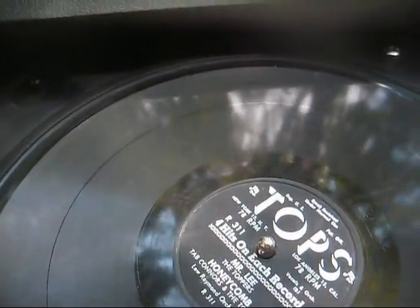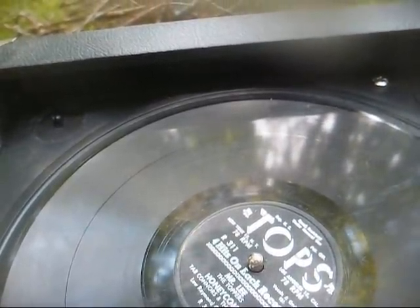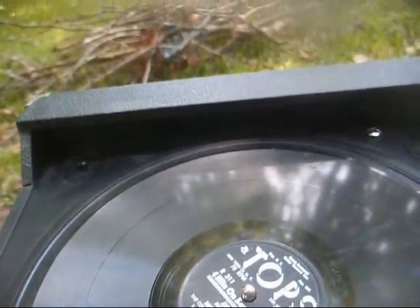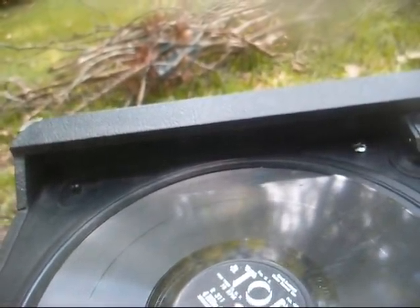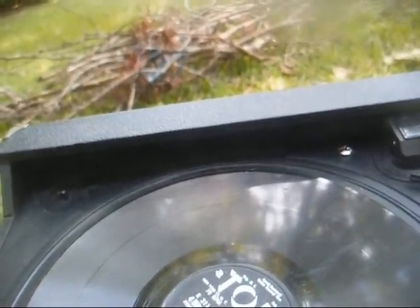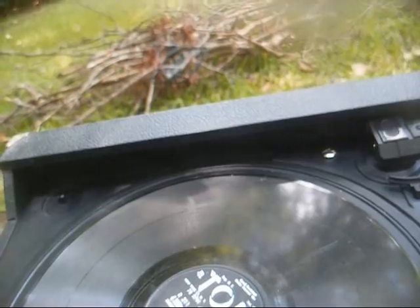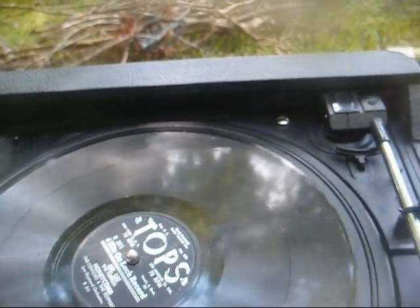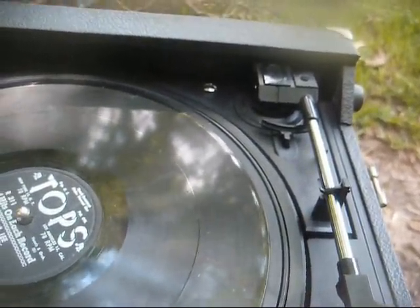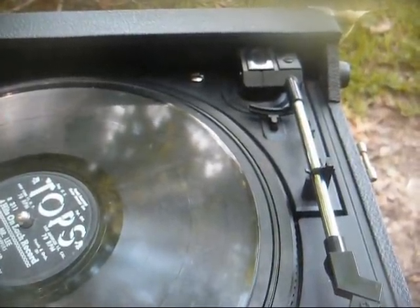Upon further listening, I could tell the audio was a bit distorted — it sounded like a rubbing speaker voice coil. However, that was not the problem. The only thing I could figure is maybe the amp didn't like that 47-ohm resistor in place of the 100-ohm — that was a little low. I usually go with 68 or 82 ohms in that position when I modify one of those amps. So I went back to 100-ohm, and that cleared the distortion up — but the audio was still weak. I remembered I had one of the Chinese knockoff cartridges out of a Crosley Cruiser that I junked, and I believe those are a little bit hotter than the original Chuo Denshi cartridges. So I put one in here, and it indeed is hotter — the record player sounds better.